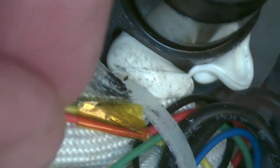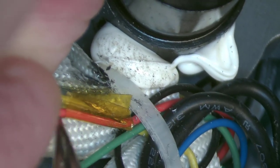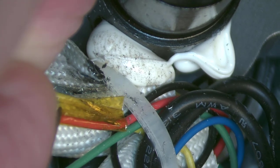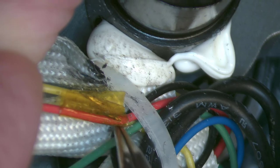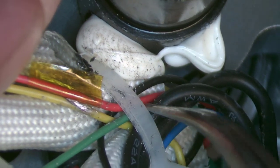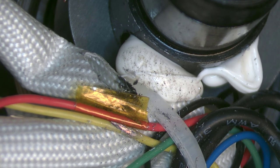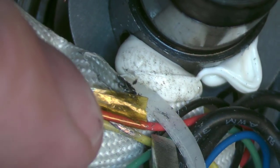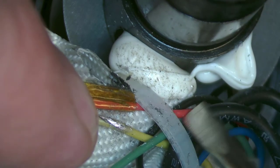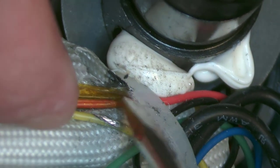And that way, I don't have any worries with respect to anything other than the yellow wire that it's bare to. And I don't want the bare areas to ever come in contact with each other. So with that covered like it is, we'll then move this red wire over here where I think it'll do much better. I don't know that those tweezers are the best tool for the job. So if I can push that guy over there, ooh, beauty. That's perfect. So right there, you know that you got it down below the level that it was before where it was rubbing.